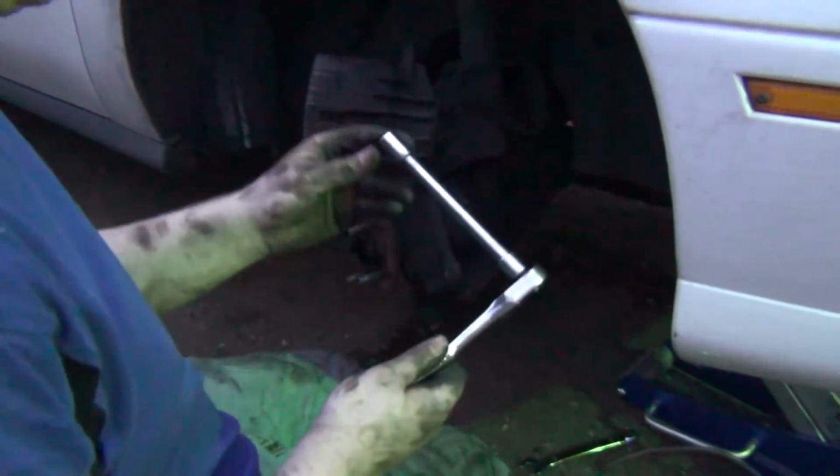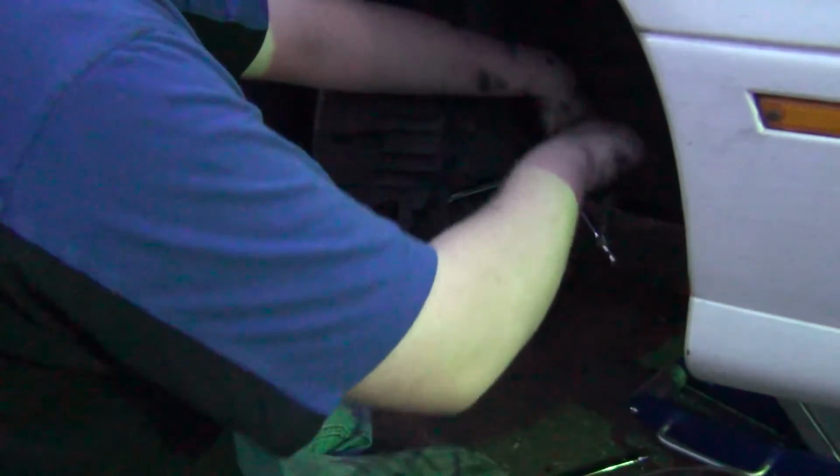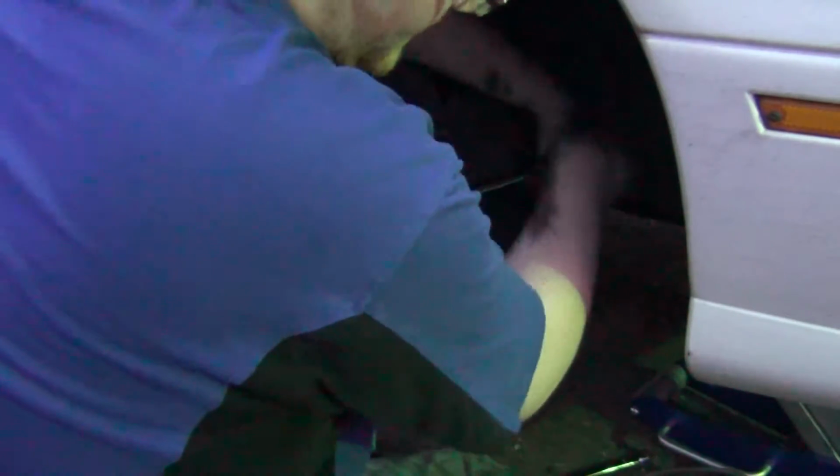So the top bolt here, the best to get it with is a Husky 6-inch extension ratchet and socket. And then you use a wrench here like that, or vice versa. You can break it free. This one's a little more stubborn. Alright, here's the big guy.